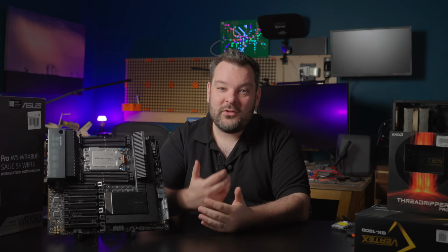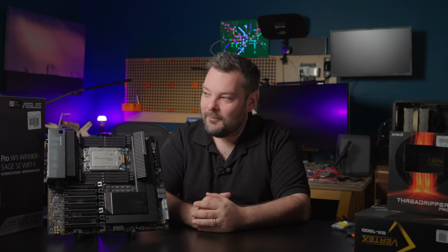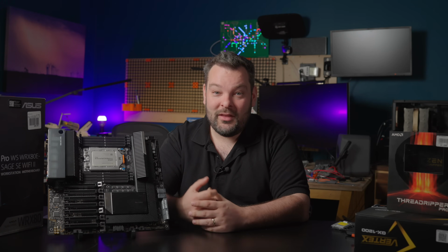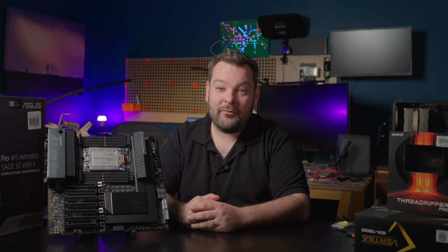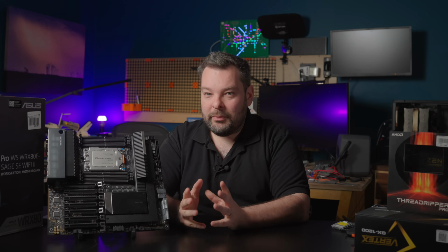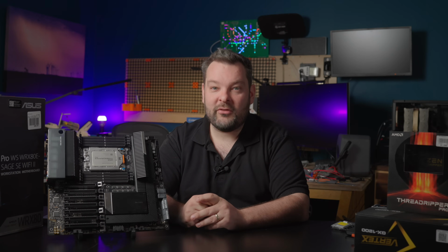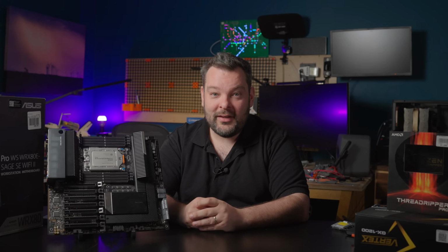So now we get into the Proxmox booting problems that I had with this motherboard. This caused a few extra grey hairs to appear in my beard. So a long afternoon turned into an evening of hacking when the vanilla Proxmox ISO just would not boot. It would hang after selecting boot at the loading initial RAM disk option. So I ended up supplying a kernel command line argument of pci=nomsi after Googling around for God knows how long. And the installer finally booted, so I was able to proceed as usual without incident.